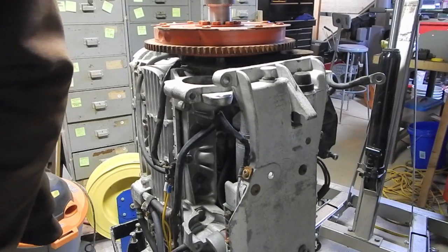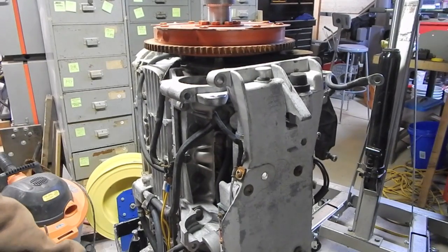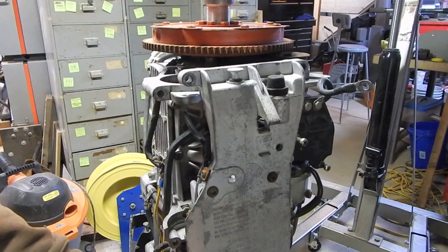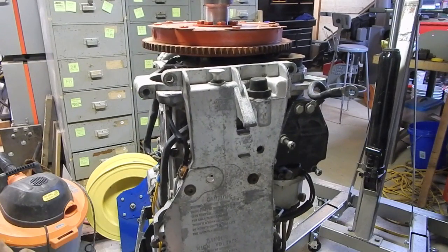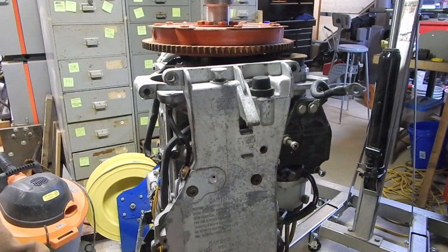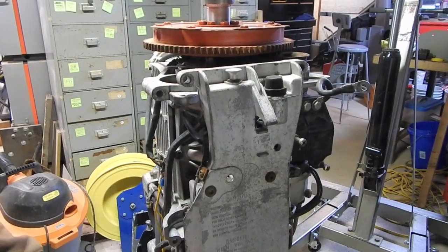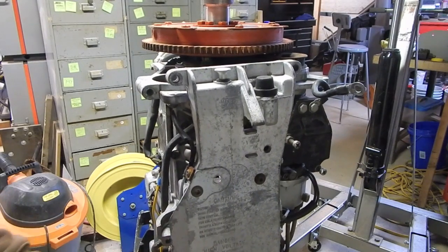So the next thing I'm going to do is undo this electrical tape that's on here so I can see these individual conductors and get a good feel for where they're going, because I am pretty sure that I'm going to find, as I suspected, that the two wires here from the alternator junction actually go directly to these two yellow connectors on this rectifier.